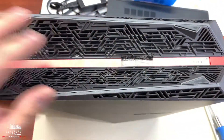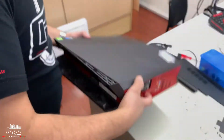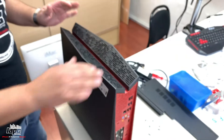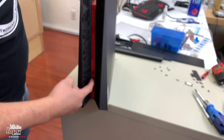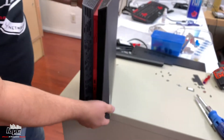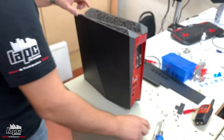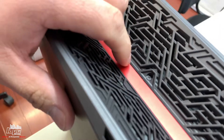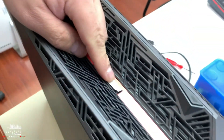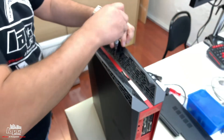What you're gonna do is flip the computer — I'm gonna give the phone to Carlos. The computer normally faces down like this, so you're gonna see the USBs on the bottom and the CD drive on the top. Flip it face-down, then take off this screw — this is the only screw visible on this part. Lift the sticker a little bit, I already have it lifted, just like that. We're gonna take out this screw really quick.